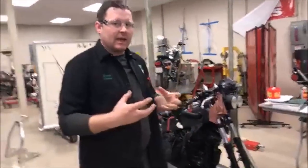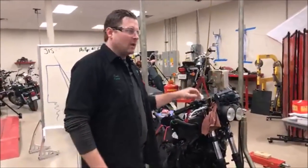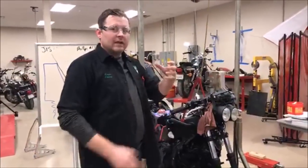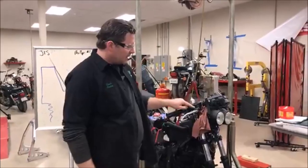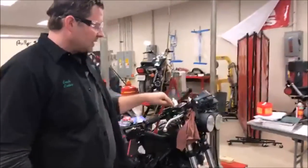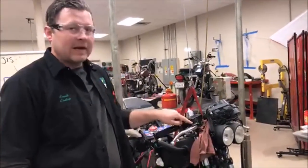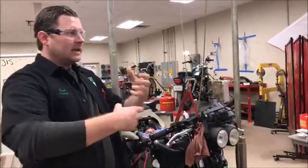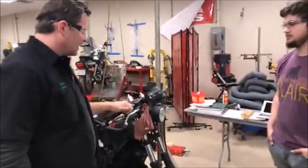The challenge that we have when you have stripped fasteners, especially when they're really small diameter, is that we run the risk that we're just going to break them, especially on these aluminum bodied master cylinders. Sometimes these bolts are steel, sometimes they're aluminum. Quite often they're steel in an aluminum body, dissimilar metals. They didn't have any anti-seize on there. They corrode and they want to stick in there like crazy.